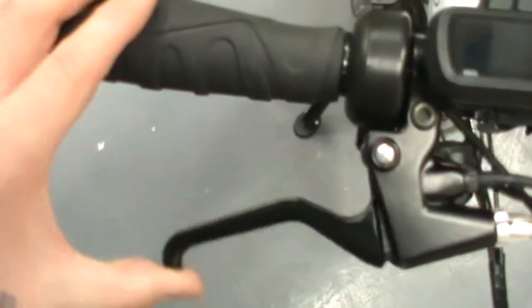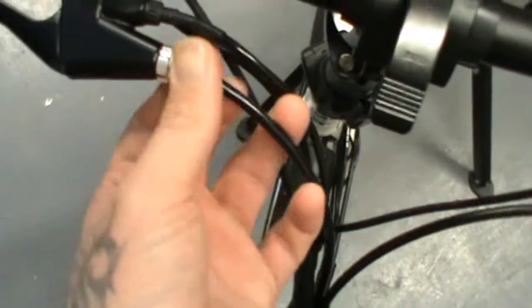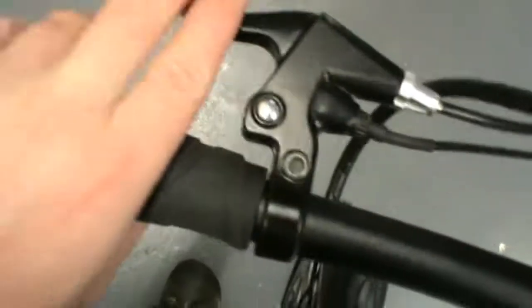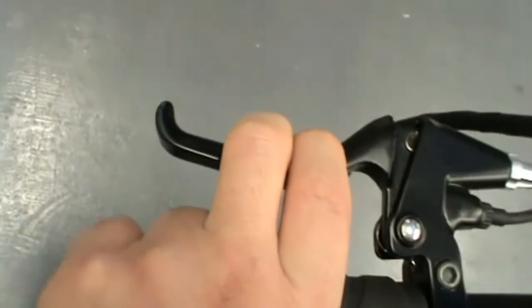It also matches the front brake. You should get into a habit of having your brakes within reason the same. That means you're constantly paying attention to the maintenance. Don't be leaving it five months to adjust brakes — adjust your brakes maybe every two months if they need it, or every time this part of the brake lever starts to hit your knuckles on the handlebar. Typically two fingers on a brake lever, and you want some clearance for your knuckles when the brakes are applied. That's a good setup — there's loads of wear and tear in the brake system before that starts to become a problem.